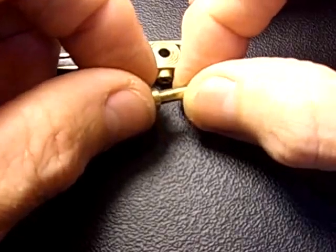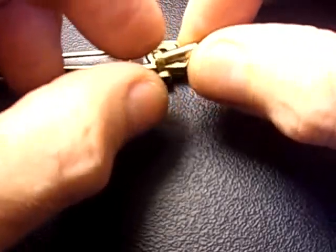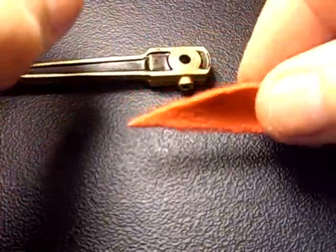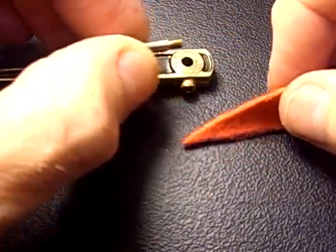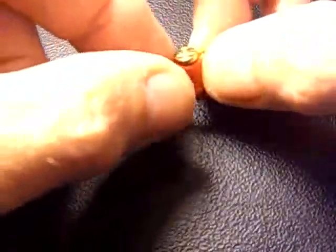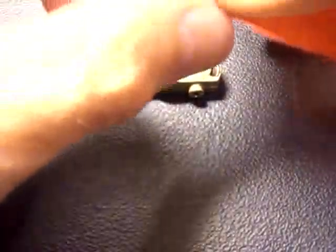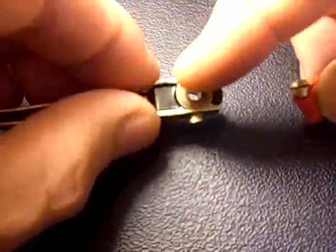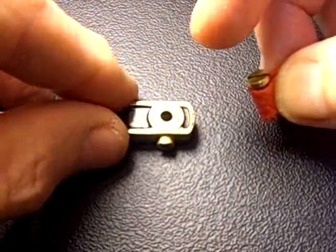It won't show in this close-up image, but this screw is already showing score marks and signs of wear. We are going to make a cloth bushing. Here is a strip of the cloth — you can see how relatively thick it is. We are going to have to enlarge the hole to make room for the cloth. To determine what size to rough the hole out to, we wrap the cloth around the screw and take a measurement with the dial caliper — let's say it's going to be 5mm. Then I'll open up this hole to about 5mm using number-size drills, one after another, until I get to the right size.